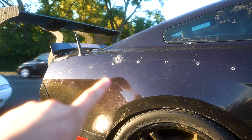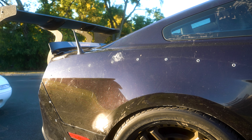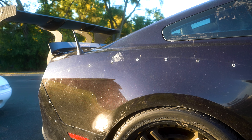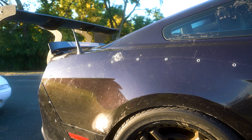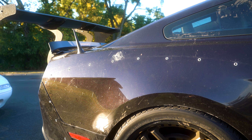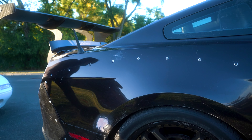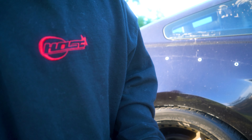Small update — unfortunately this side of the car all needs to get shifted over literally one centimeter. When we put the kit on it looks kind of bad from afar, it was slightly off. So I need to sand off the top of all these rivnuts and move the entire kit over an inch. I got an eight-inch orbital sander — Zaxson brand, same as my other tools. We're gonna sand down the tip on the outside, line up the kit, position it and move it over. Then I'll have to cover up any part of the hole that'll be seen past the kit. Wish me luck — I've never done this before.